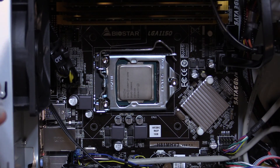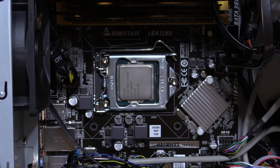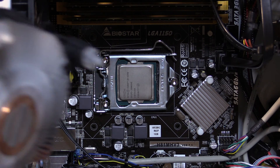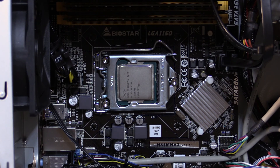What I'm going to do in this video: I'm going to apply this cooler on that processor with the pre-applied paste — no changes, just snap it in place. Then I'll fire the computer up and do some testing. I'll run several tests with Prime 95, get some max temperature readings, and monitor the case inlet temperature to make sure it's not affecting the temps. The case will be completely closed up, just like normal operation, so the test will reflect real-world conditions. Then I'll pull the cooler off, see what coverage we got with the stock paste, clean it up, put some aftermarket thermal paste on, and do the testing all over again to compare.